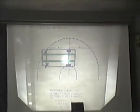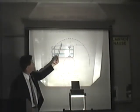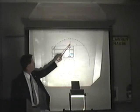And yes, Susan. Is B the whole length of the line? No, it's half the length of the line. So it's from like point C to the... Yes. X to X prime is the full line, and B is 1/2 of that line. Okay. So using trigonometry, that's all it is. We know two sides, and we can just plug this formula in. And that'll give you your turning diameter. There's another formula for arriving at the same thing, but this is the simplest one I've seen. There's more than one way to calculate this from these measurements, but I think that's the simplest one.